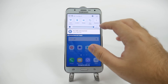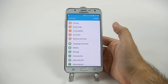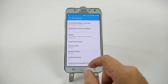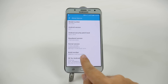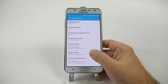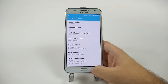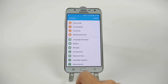We're going to start off by going into the Settings portion right here, swiping all the way down from the top, and you're going to look for About Device. From here, you're going to swipe a little bit more up and go until you hit the Build Number. The Build Number portion you're going to hit repeatedly about seven times. And then once you've done that, you're going to hit back once right here at the bottom. And then you're going to have a new option down here called Developer Options.